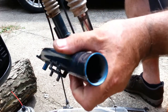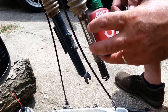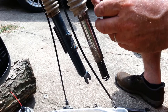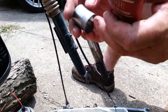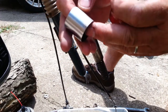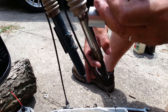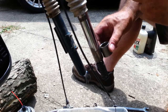Got the tube all cleaned out. Got this all clean. Loctite 640 sleeve retainer, and this hardens well enough to use in 60 minutes. Well, here's the sleeve. And notice the sleeve has some pretty severe wear on it. I can't just buy just the sleeve. You can see some wear here too on the fork, because this sleeve had been slid up to here.